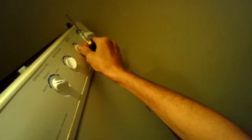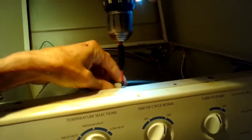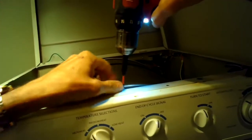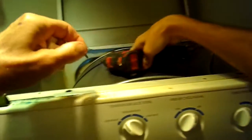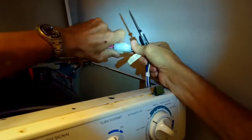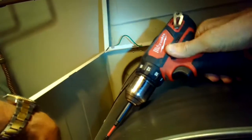I'll unplug it. I'm going to take a Phillips head screwdriver and zip out this little piece at the top — it's a retaining piece that holds the tumbler into position. Then I'm going to take my knife and cut the zip tie off so I can remove this modular connector that's bringing power to the timer.